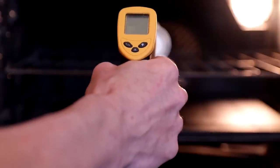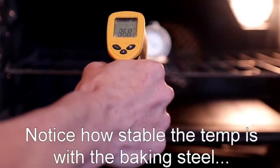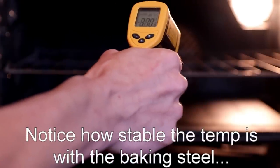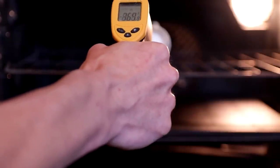But for right now, we're going to let my oven keep going for probably another 15 minutes, because I put it back out of calibration to where it was originally, and I think what we're going to see is a temperature right around 375. Since we've been having issues getting the focus to work on our internal thermometer, we'll just use the IR gun. And what do we got there? Looks like right in that 368-370 range — so about 20 degrees off.